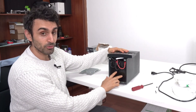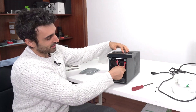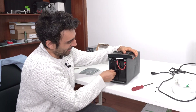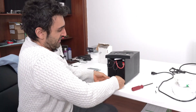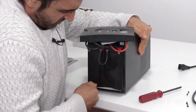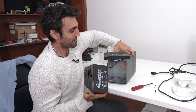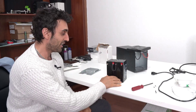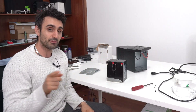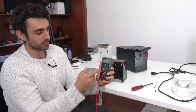These are two battery cells — it actually has six cells inside but there are two main batteries. I'll unplug the red and the black and then pull them out. They're very heavy, so be careful when pulling them out — they might fall off. As you can see there are two battery units here and each of them is 12 volts.